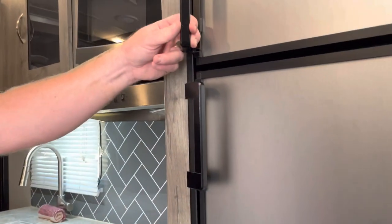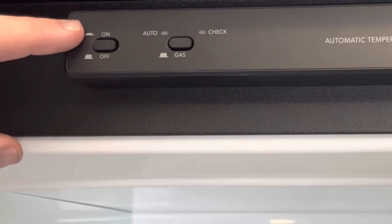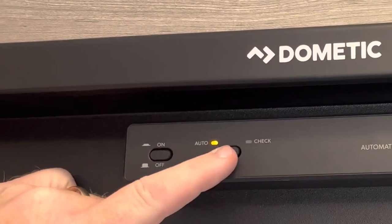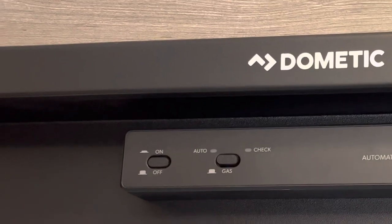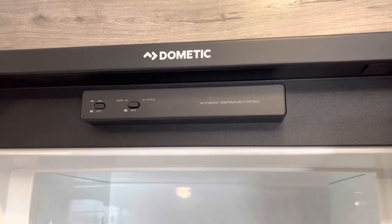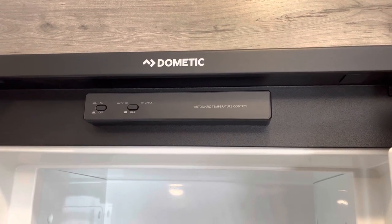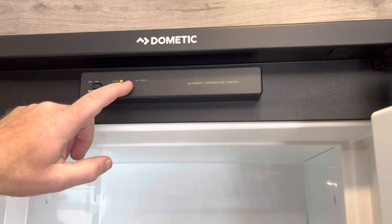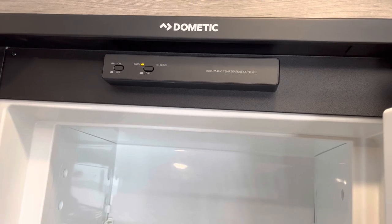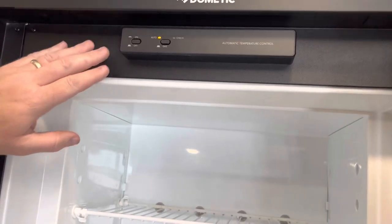Over to the refrigerator. As most RVs do, it has an automatic button to switch between electric and gas. This one is on auto right now. If you wanted to use just gas, push this button. It does get colder faster running on just gas. Make sure your unit is as level as possible when you're parking it — the more level it is, the better the refrigerator is going to run, and the more comfortable you'll be. If you're going to be unhooked from power for some time, I would recommend just running on gas. It doesn't use very much — it's very frugal. This controls both the freezer and the refrigerator.